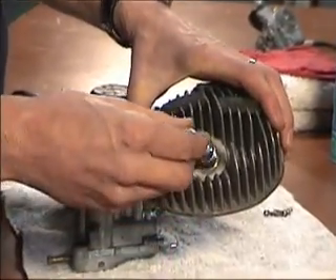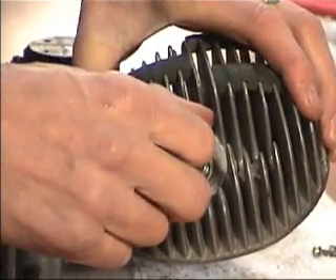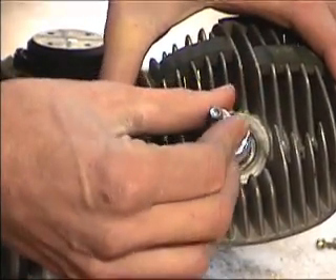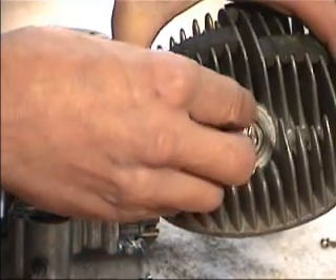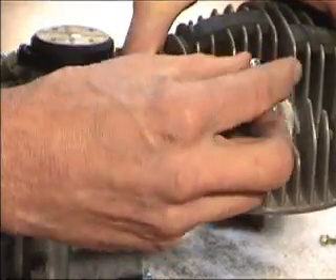The best thing to do to start out is to get the plug started and turn it clockwise slowly. If you feel any resistance at all you're in the wrong spot, and a lot of times if you're having trouble getting it started, try turning it backwards a couple of turns before starting it in the proper way.